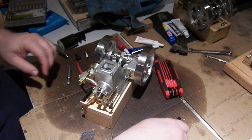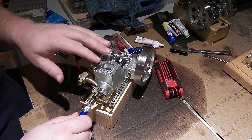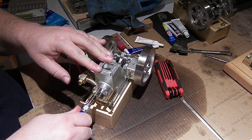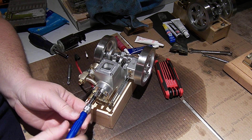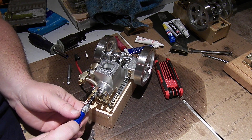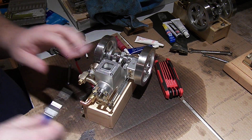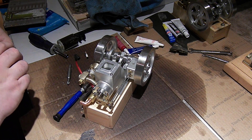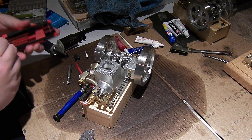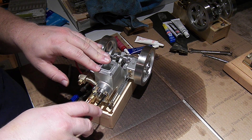The first thing I'm going to do — and this is probably wishful thinking on my part — is pull the head off and see if maybe it's just locked up because the piston o-ring, because that's rubber, has wedged into the cylinder and is jamming it up.